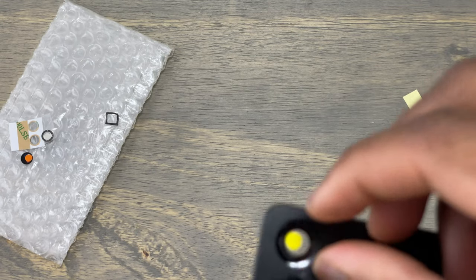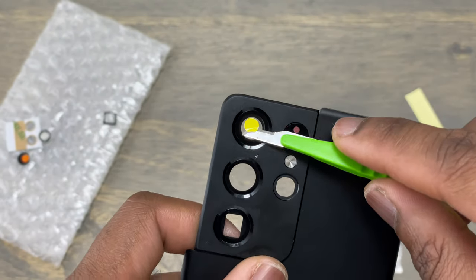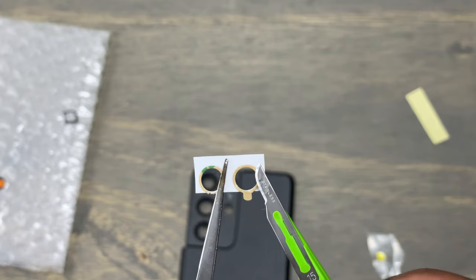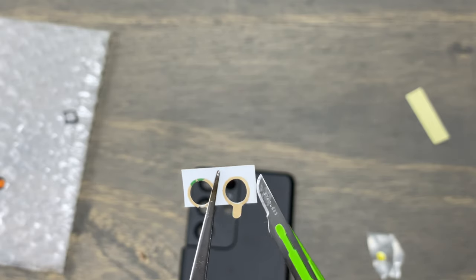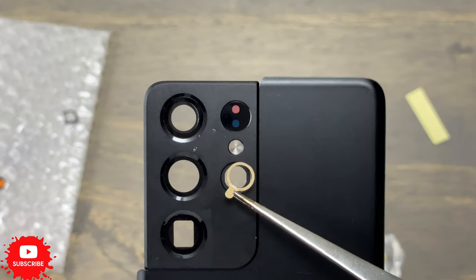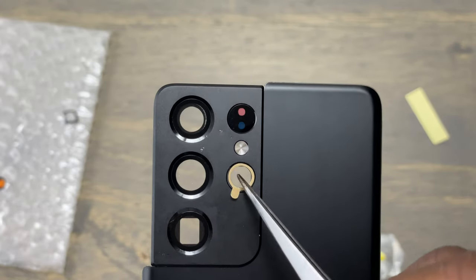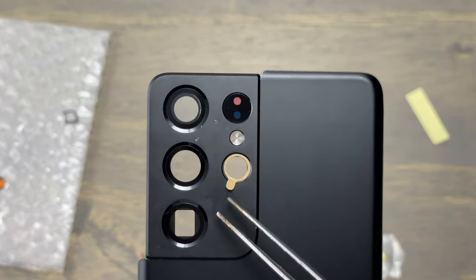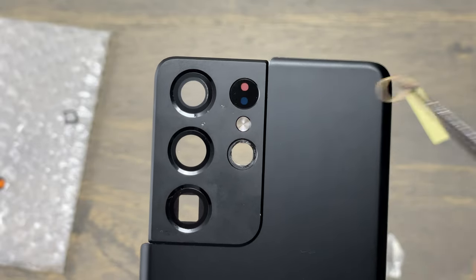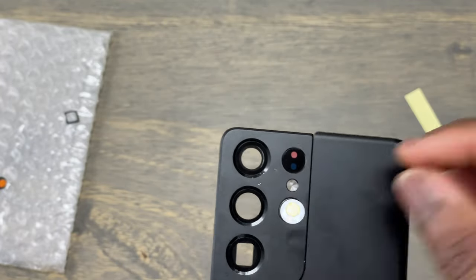When you finish installing the lenses, remove all the yellow dots. You can remove the yellow dot using a blade or you can use your fingers. Since the smaller lens is smaller, you need to be more careful because there is a risk of damaging the double-sided tape or even losing both of them. If it gets difficult to lift the double-sided tape with your hands, use a blade to safely lift it. Apply the same principle: install the double-sided tape, apply some light pressure, then start installing the lens. The yellow dot should face you.